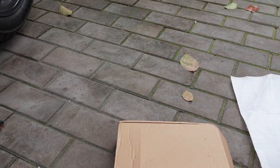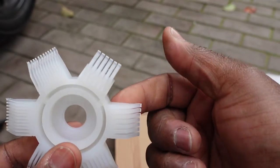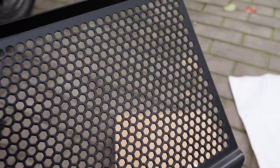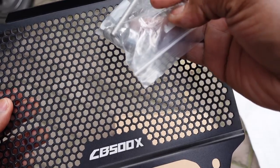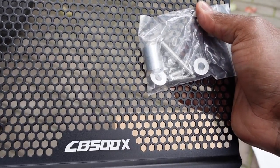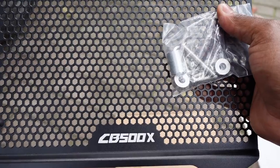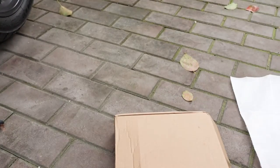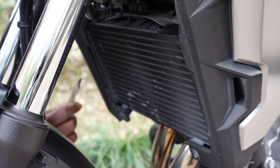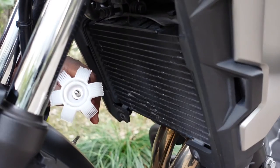So that's about it. I'm going to first use this tool to straighten the bent radiator fins. This tool only cost me about $1.50, and the radiator guard — the complete assembly — cost me about $12, which is the equivalent in Chinese RMB. So these are not very expensive, but definitely upgrades that are very necessary considering what happened to my radiator. So let's go ahead and do the correction — the straightening of the radiator fins — and then the installation of the radiator guard. I'm going to use a screwdriver to try to move the radiator fins a little bit first, just to straighten them slightly, and then I'll complete the repair with the tool.